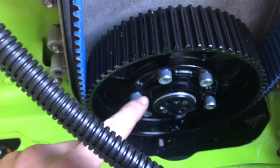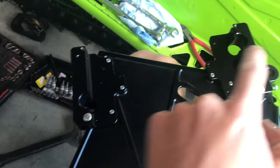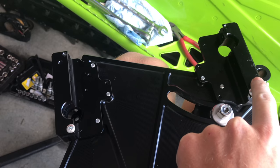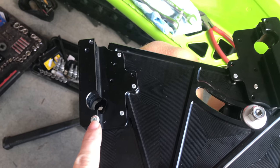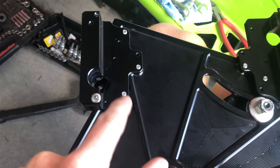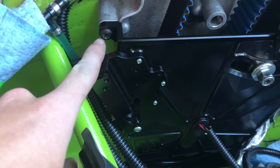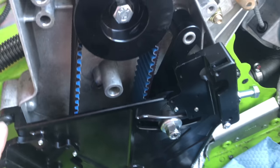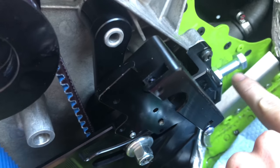There's a little black piece that goes around here — it's got two holes. Now on the front of the cover, you're going to install these two plates; this is going to hold your oil tank. There are three bolts on each side, and this is the stop for your oil tank. Make sure to put a little Loctite on those when you're putting them on. Once you get these on, you can start installing the cover — there are six bolts. Use the original bolts from the chain case. Then install the tensioner and the bolt to hold it.